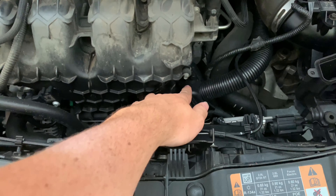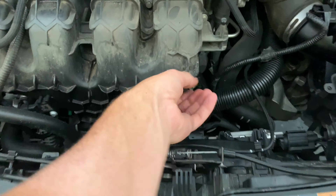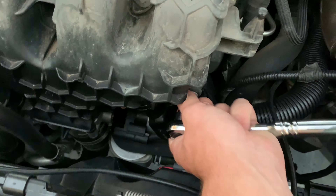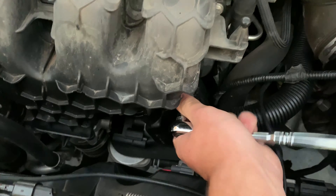The Sound Symposer is located right there. You got one bolt holding on right there, and two bolts holding on down there — right there and right there. So grab your wrench, place it into the socket very gently, and then just get those three bolts off.